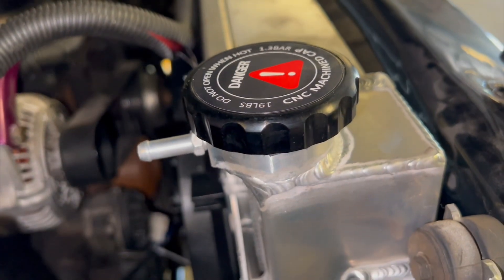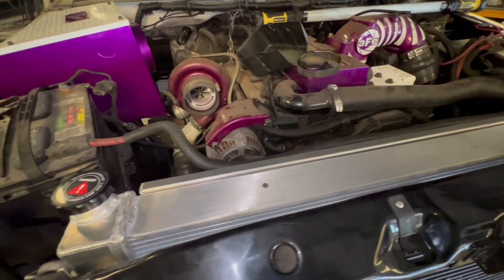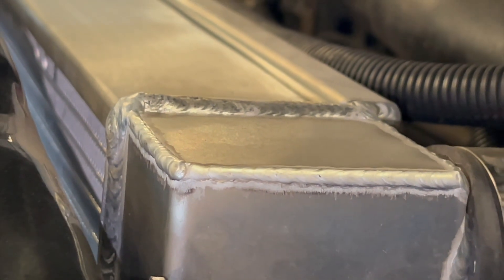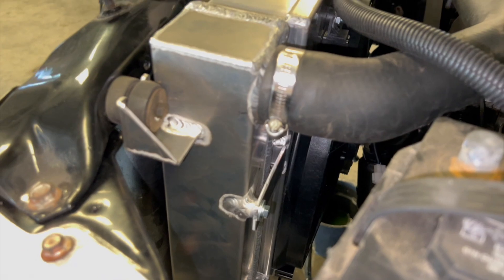Overall, I'm super pleased with the construction of this radiator. It's a four-row — most cheaper options are only two rows — so you're getting 30 to 45 percent more cooling than a cheaper stock option. And with the AA 5052 aircraft aluminum, this radiator is going to hold up for a very long time.